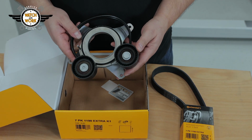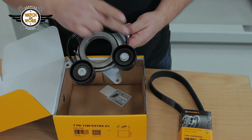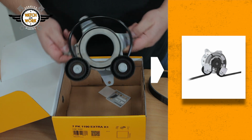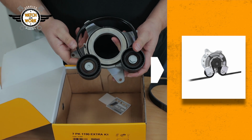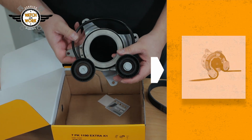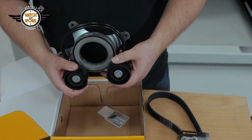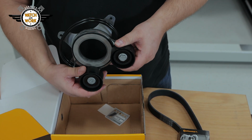And we also have our Omega tensioner. It's so called because it has the same shape as the Greek letter omega. This tensioner is able to move, allowing us to compensate for the dynamic load changes in both torque directions. There are various functions we can implement here, including recuperation, the boost function and the start function, for example.